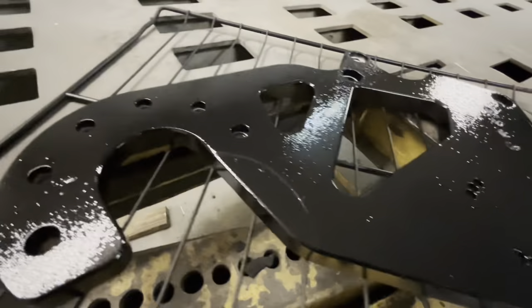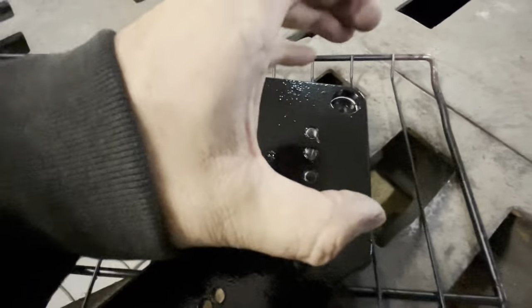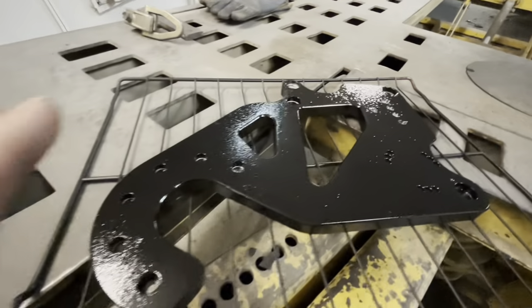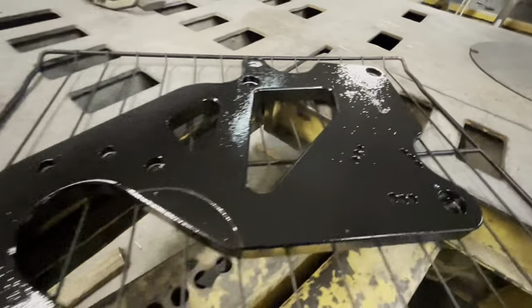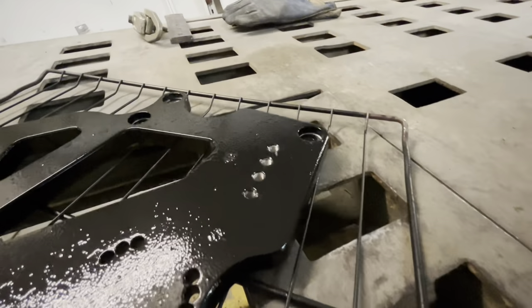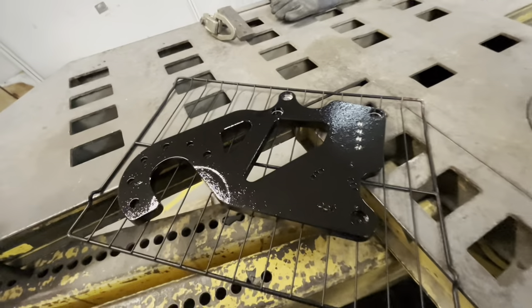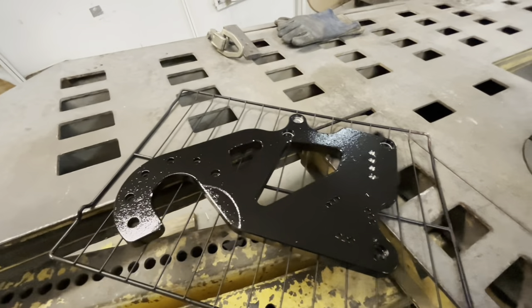So it's orange peely — very heavily textured, has some clumps. But this is all going to be behind the pulley — there's going to be a big pulley and a tensioner pulley sitting here, so a lot of it gets hidden. The sides of the bracket look really good, but the top has this ugly texture. Now this is going to be matte — you can see right now it's glossy and wet, it's melted basically. As it cools it's going to do the matte satin look. I'm not complaining because if it was spray paint or base coat/clear coat it's going to chip, and this is just not an item you want chipping. I'd rather have some flaws than be chipping a lot.